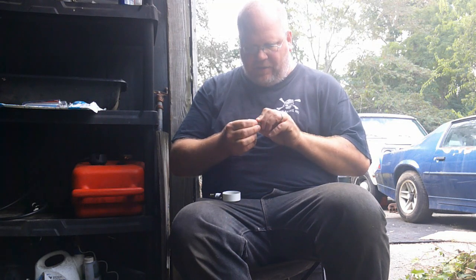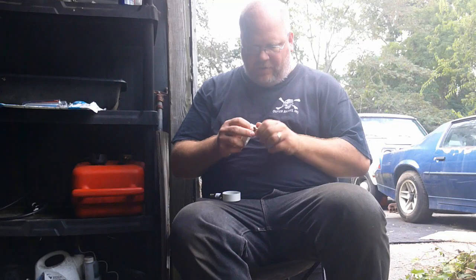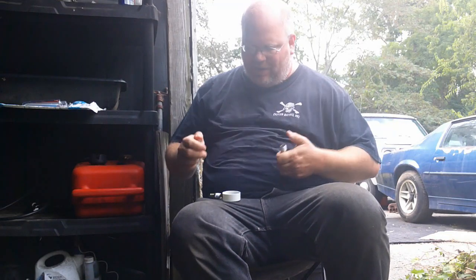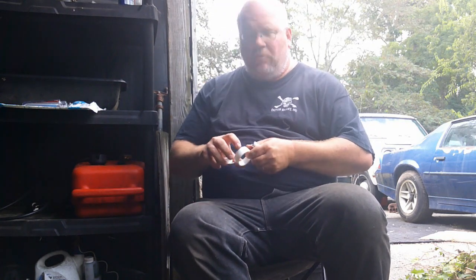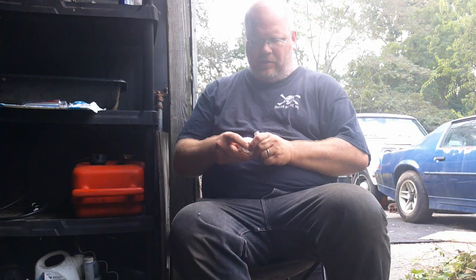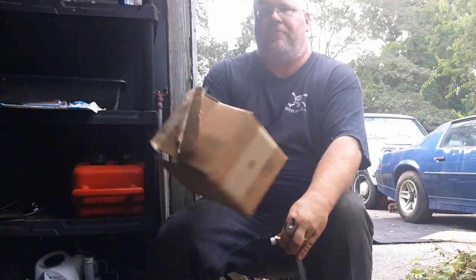If you do that, you'll have the Teflon going on the right way. You don't have to remember anything special, just act like you're tightening it. And that way too, if you just so happen to have something that's got left-hand threads, you won't get confused. Alright, so while I was in the garage getting my wrench, I went and grabbed the box.